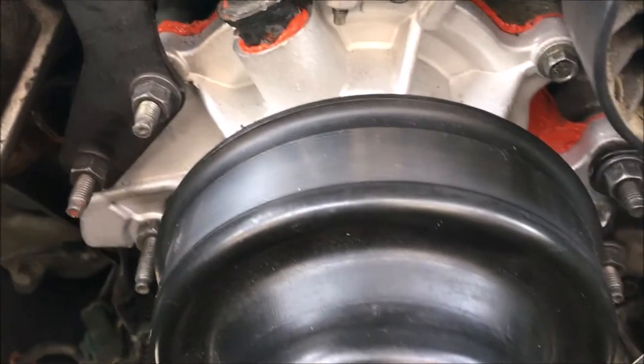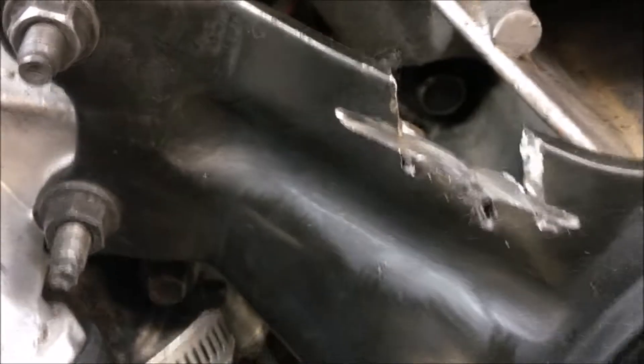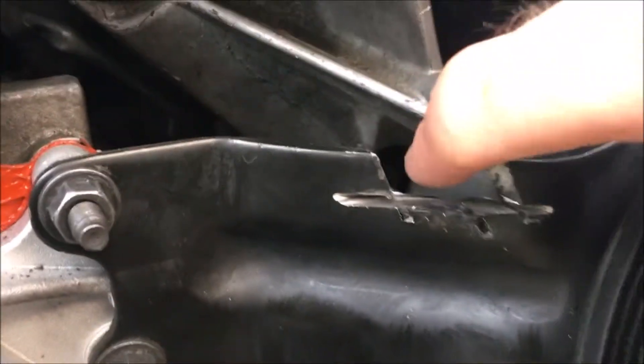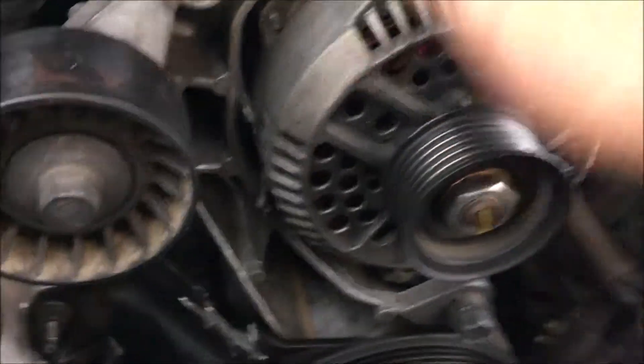You have to pull this pulley off and they've got some real tricky bolts. You can either choose to remove the power steering pulley, or like I did, cut a notch in it so you can get to that tricky little bolt back there. You can get it with a wobbly or a universal, as there are some real hard-to-reach bolts taking off this accessory side.